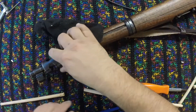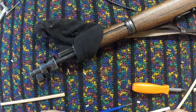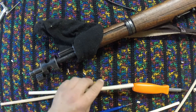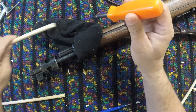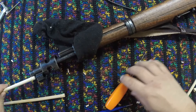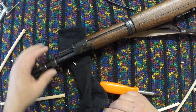To get this off you would need to remove your front hood, and the advice on that is: don't. Just don't do it. If you find yourself having to take it on and off, getting it back on can be a bear because you've got to get it split open enough to go on. What I ended up having to do was get it upside down, wedge something into the gap to make it bigger, take a dowel and wedge it open into the wood, then position it over and knock it on. It took me about 40 minutes, so just don't take the front hood off.